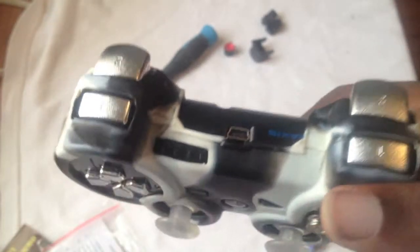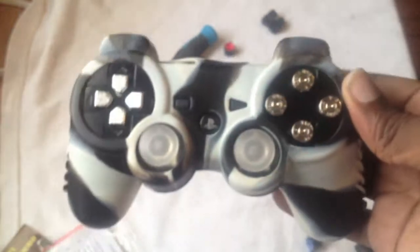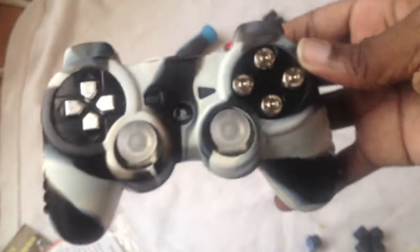On the back, silver R2 and L2 buttons. As you can see, they are all functioning perfectly. The hardest thing would have been the R2s — I really didn't know what to do, because when I saw it, it looked like there was nothing in there. These things are supposed to grab onto something, and I thought I couldn't do it, but what I had to realize was I had to pull the piece out of the old ones. So when I yanked it out, I just replaced it and I was good to go. I learned how to do that on YouTube, so if anybody's curious, always go to YouTube to learn how to do this. It's not that hard.